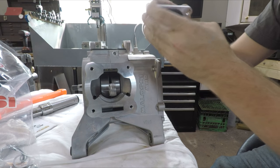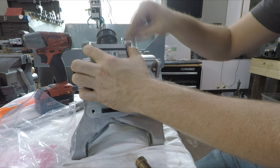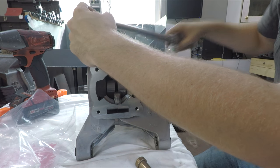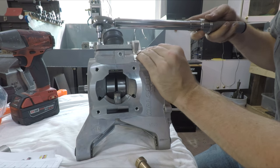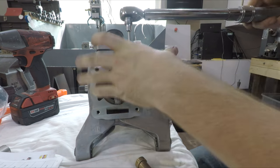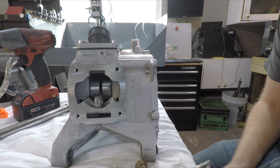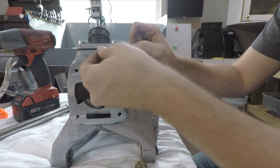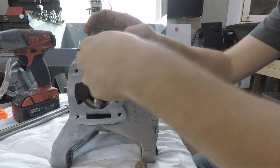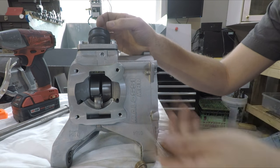Install your cover, put your intake bolts with washers — supplied in the kit — and the torque spec for these is 10 to 11 newton meters, around 8 foot-pounds or so. If you're using a vacuum fuel pump, you'd have to drill out that hole and install one of these adapters facing sideways or upwards — if you face it down you're going to have a problem with your cylinder. It is a sealed hole so you will have to drill it; if you don't, your fuel pump won't work. I don't actually need it so I'm not going to install it.